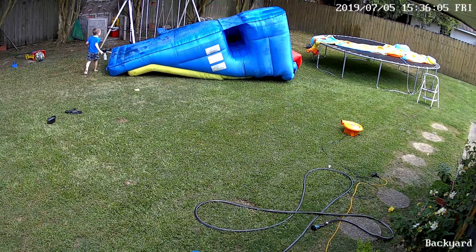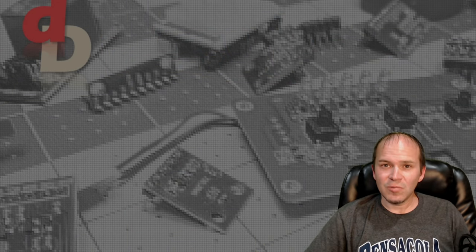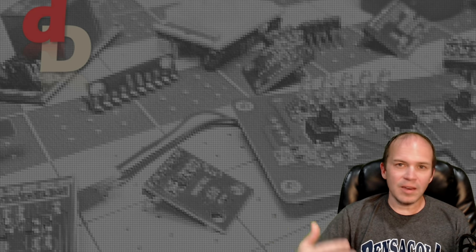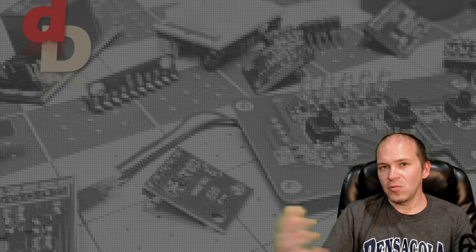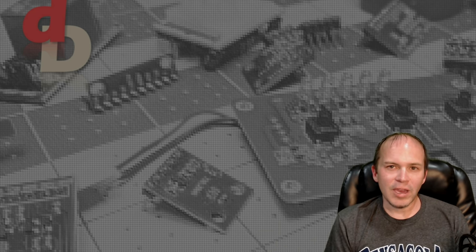Didn't have any issues with frame rate oddity, as I did for some reason with the Annke. Don't know why, but at night, even when we tried recording several times, when we would be walking across the yard, it would seem to be dropping frames. I'm not sure if the CPU in the camera itself was having issues trying to overcome not having much light and wouldn't allow it to record at a higher frame rate in 4K.